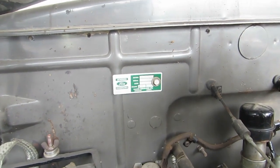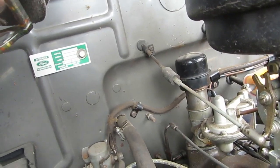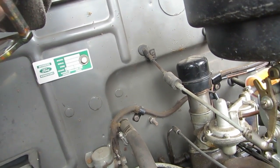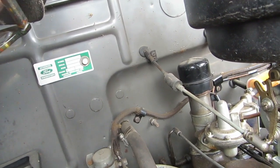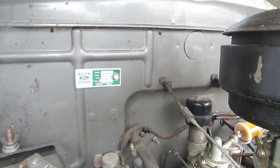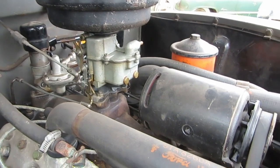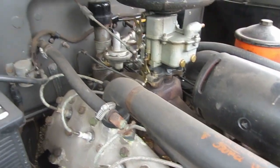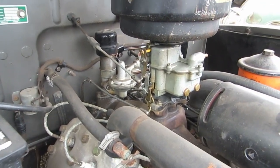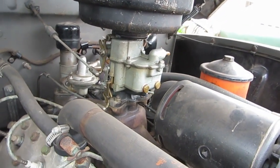What's the bore on it? 20 over. So, cranks 10 under, and mains 10 under, throws 10 under. Oh, good, so it's the first cut on it. First cut on the bores, too. So at 1,000 miles every 50 years, it should last for several thousand years yet. Yeah, we should be good then.